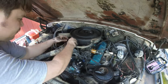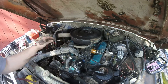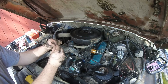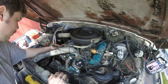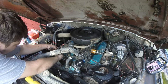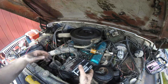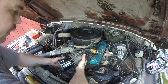If it's too far away, it tells you to add these little copper washers here as spacers until you can get it at the right height. Alright, that's attached. I've got to neaten these wires up with a zip tie somewhere. For the spark plug wires, so I don't get them mixed up, I'm just going to do them one at a time.